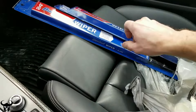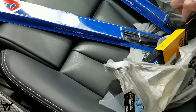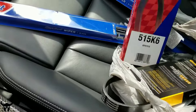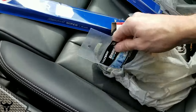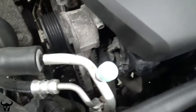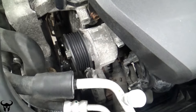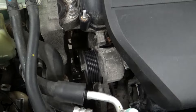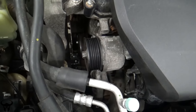The serpentine belt is just like a normal serpentine belt. We have a Continental stretch belt, a Duralast serpentine belt, and some zip ties for the installation. There's the tensioner pulley that you can pull back using a 14mm, and the stretch belt is underneath the car, so you have to raise the car up.